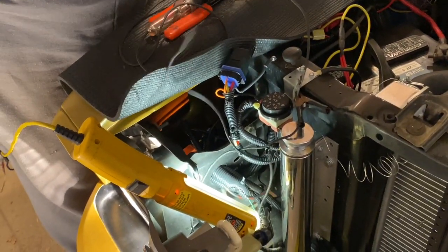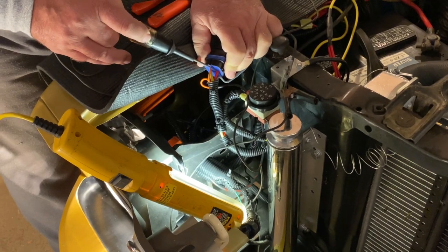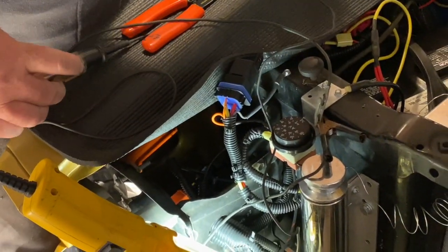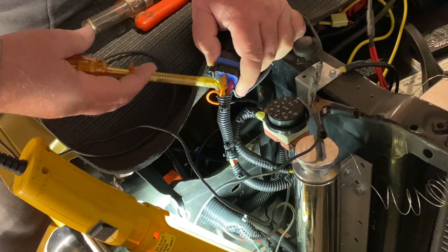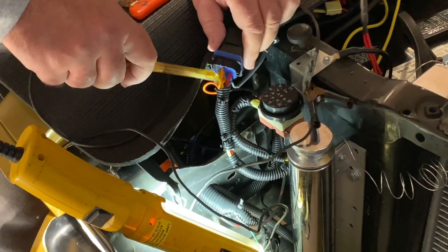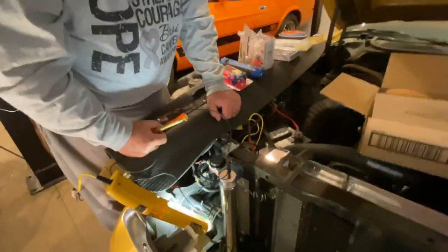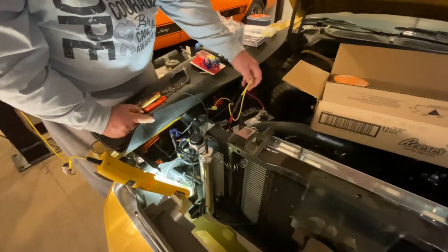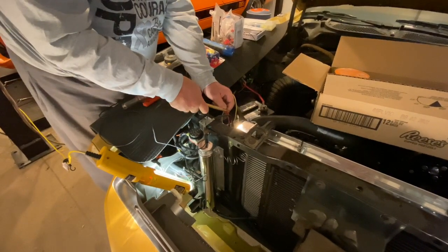What I want to show now is that the heavy red wire has a constant 12 volts going to it. The yellow wire — I'll use the other probe for this one because it's going to be harder to hit — has no voltage going to it currently, but now it does. So that tells me the big yellow wire is what I want to use to trigger the LED lights. The yellow wire comes through a plastic conduit and runs into the two red wires, each of which go to the two cooling fans.